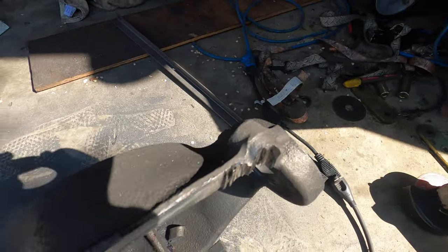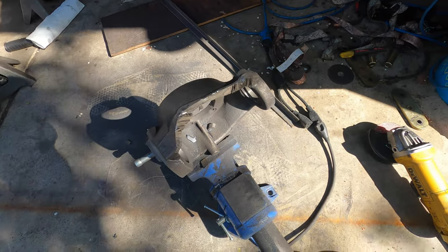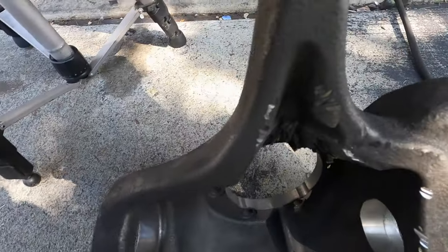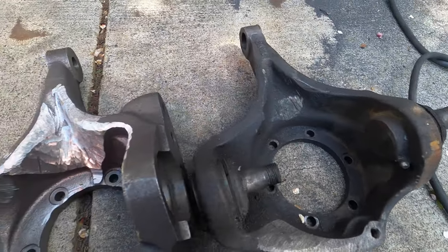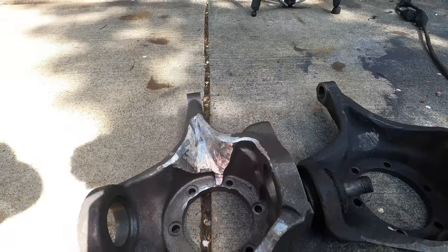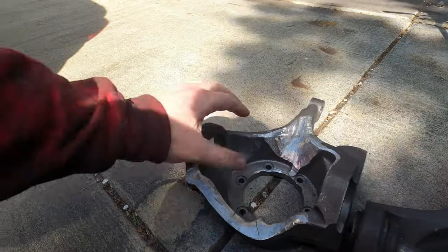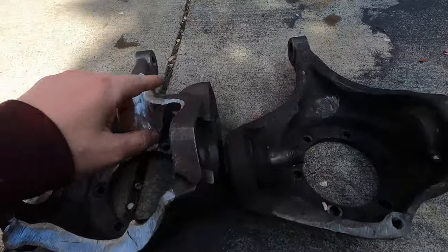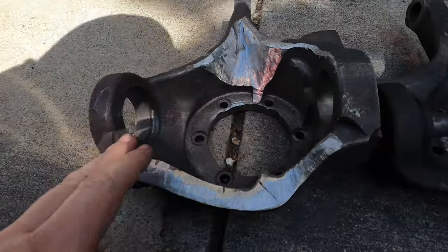There's step one — taking all that material off the backside. That was a lot. Now we need to go over it with the grind wheel, get it smooth. I'd like to go over it with a flap wheel, but we're going to have to do some fitment once we get it on the axle. We've got to flip it over because we have way more to cut off the other side. We just cut out that huge chunk right here — inches of metal — and this arm total is a lot thicker than the stock one. It's funny because in the aftermarket knuckles, they're basically advertising these as way stronger because there's all this added material up top. But I need to do the opposite — I need to take all that material off so I can swing the bell in right there. It looks pretty similar to the stock one; we might have to grind a little bit off right here.